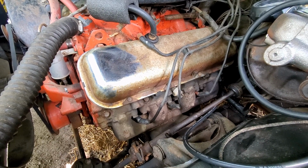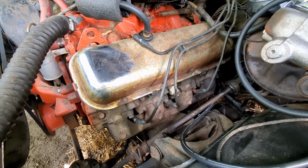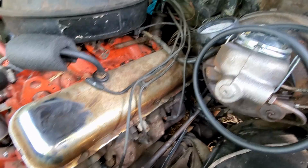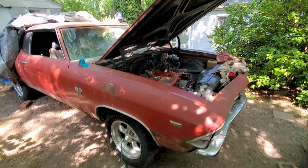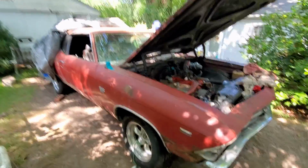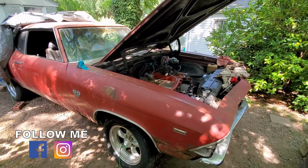We're going to have to pull that valve out and clean it out and get it back going and see what our oil pressure returns to, which it should return to normal. Well, we weren't really expecting to do anything major like dig into this oil pan. Hopefully that's not going to be a really big task, but we're going to save that for the next video.